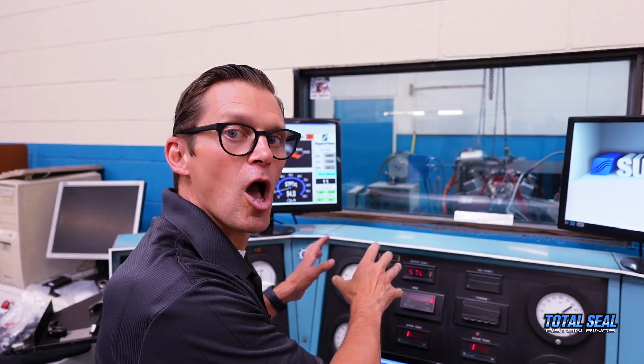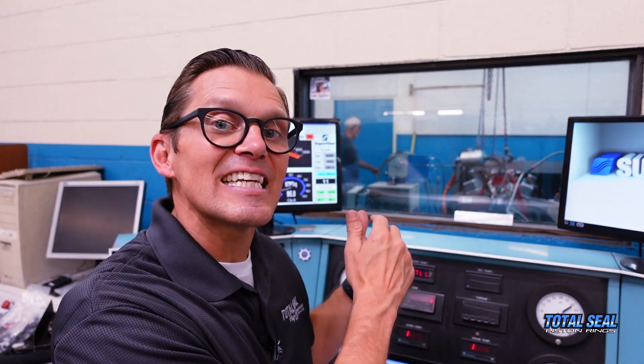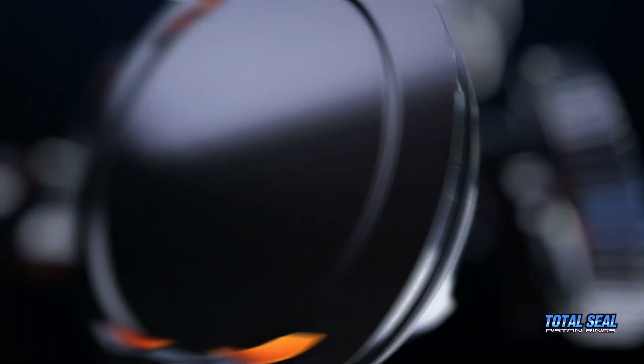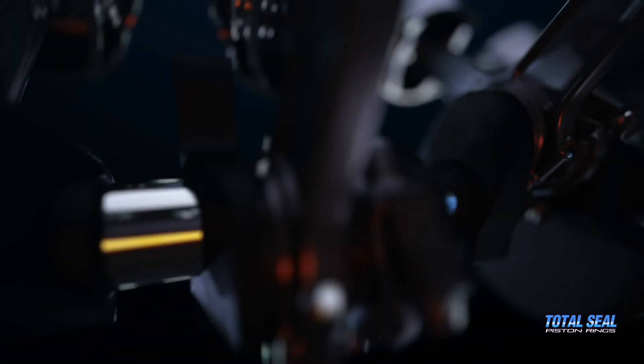Now with that same hone, if we did this with a steel ring, it would take a little bit longer. We can adjust the hone to make it come in faster for the steel ring, but this hone is smoother — like you would use for a ductile molly ring. So we're going to see how long it takes for these rings to bed in. We know the ductile molly ring takes two, maybe three hits, and then the numbers stabilize. We're going to let the engine run the 30 minutes, let everything come up to temperature, then make some pulls and find out what we got.